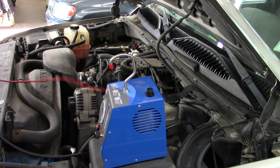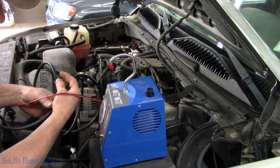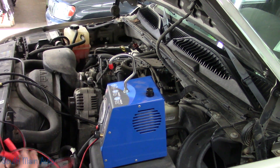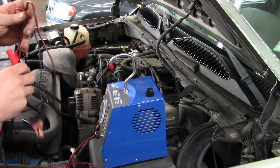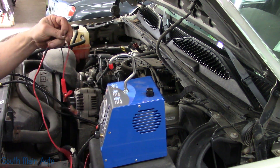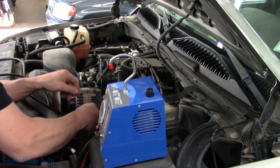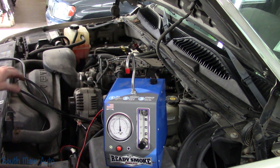If we put on the smoke machine and hit the button and all of a sudden the system seals tight, chances are the purge line is full of charcoal and plugged up tight. Before we hook this up, we should make sure she blows smoke. I've regulated my air hose down to about 60 psi — I had one smoke machine back in the day where I hooked it up to full shop hose at 160 psi and it did not like that. We're going to hook this up to the battery port down here — it's a little easier than the side-post terminals.